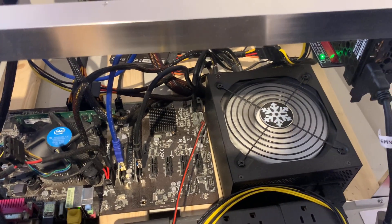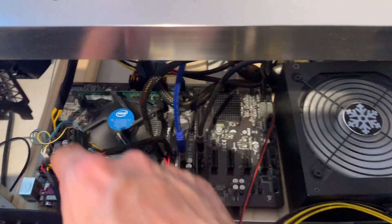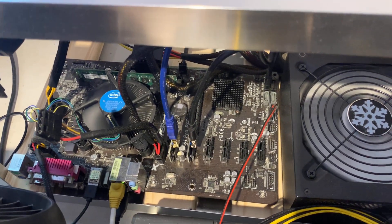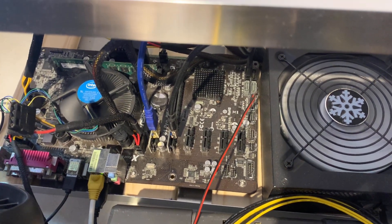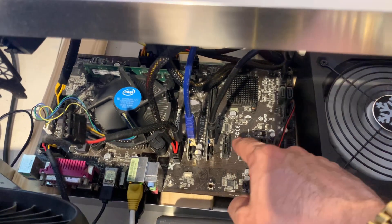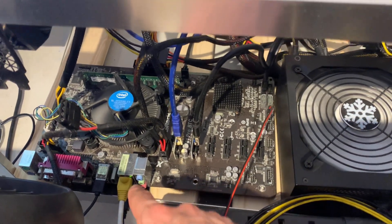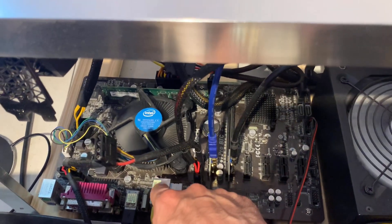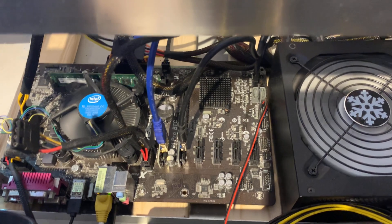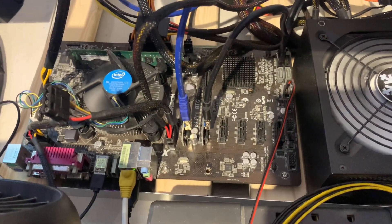The next part that is often defective, although less so, is the motherboard itself. I've seen quite a few faulty motherboards — completely broken or burned out. I've also seen multiple or single GPU PCIe ports break, so you could have all of them working and then one suddenly stops. I've seen USB ports break, the network controller break, and even individual pins break off. If one of these resistors breaks off, that's typically the end of your motherboard — they are very delicate.